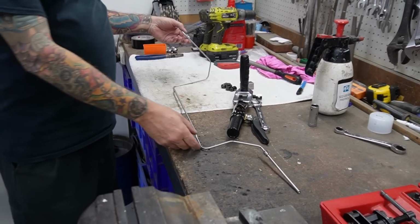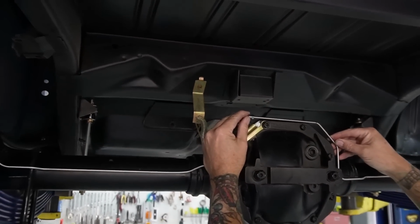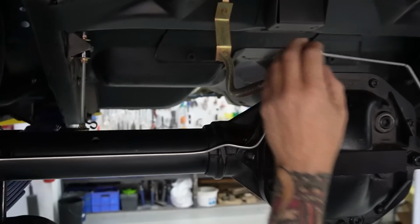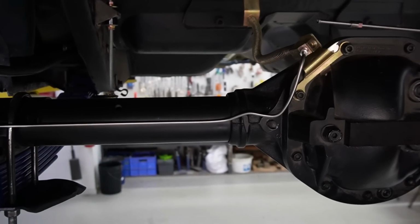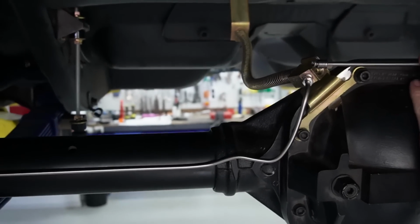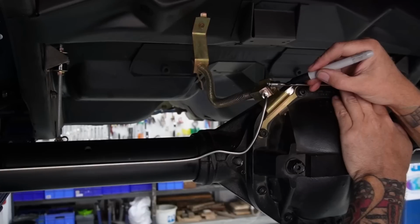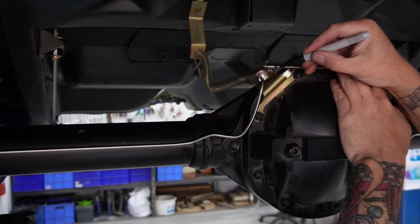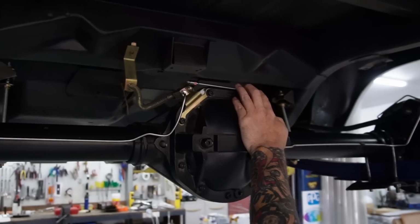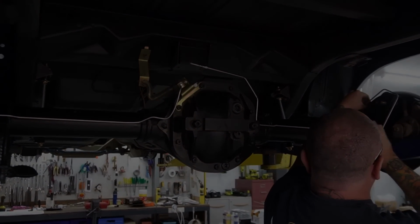All right, well, we'll see how that looks now when he gets it on there. I'm just going to come across like that and then just bend it in, I think. So now that he's got the fitting on there, you can't do these little tight bends. If you do a little tight bend, you don't have enough pipe to do the flare. So it's working out which thing to do first, and that's where the experience comes into it.